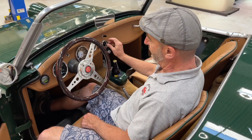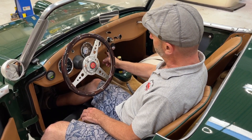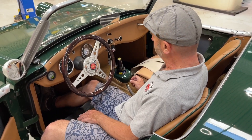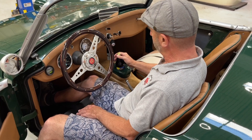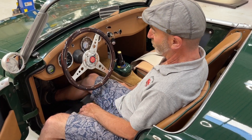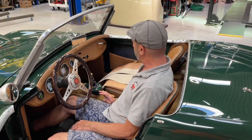So inside the cockpit, very straightforward: key on, forward, step on the gas. The e-brake off. Now the e-brake is particularly critical in this car because we don't leave it in gear. In fact, we only have a direct drive system — no shift to engage or lock. So the e-brake is very important to stop the car from rolling away, and it will roll away. So make sure to remember the brake every time.